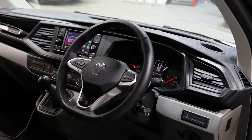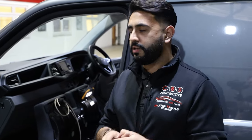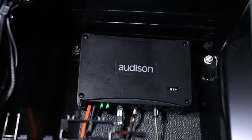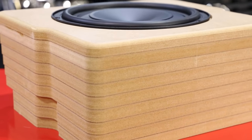We've also got a processor — part of the 8.9's 9-channel processing — using Audison bit software. This allows us to de-equalise the head unit, correct all the errors coming from the factory Discover radio in the vehicle, manipulate and get the best possible EQ, then send that to the amplification stage which sends it directly to the new speakers. We've also got a little controller in the top panel for sub level control, and we're setting up two EQ presets — a rhythm one and an acoustic one — all via the bit tune software.